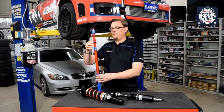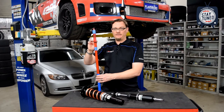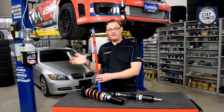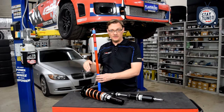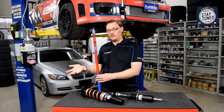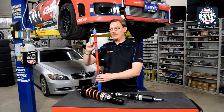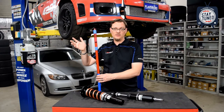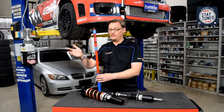So here we've got the strut probably about 1.5 inches up. In talking to the guys from Feal, ideally you want to have about 30% of your suspension travel for droop travel, and then the remainder for compression travel. So for about 1.5 inches up here, this is 5.5 inches, because that's the standard suspension stroke for a Subaru coilover.